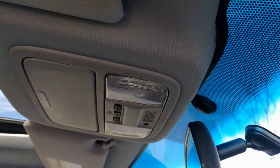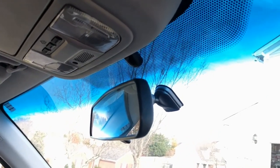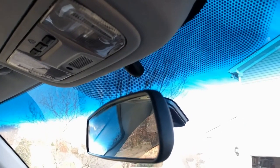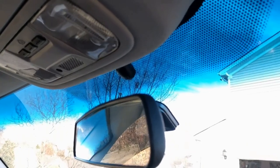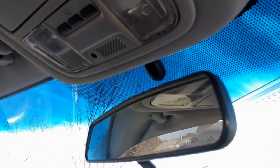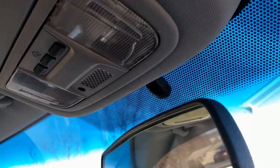One of the main questions I had with this installation was how to place the microphone without it looking terrible. What I've done is taken clear gorilla tape — I'll put a link in the description — and mounted it just below the headliner. It's actually out of the line of sight when you're sitting in the driver's seat. Then I've run the cable, tucked it between the headliner and the windshield.